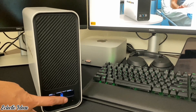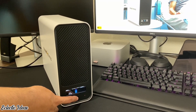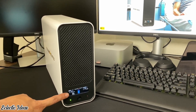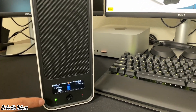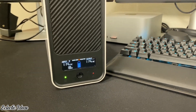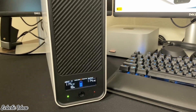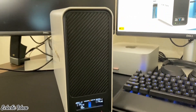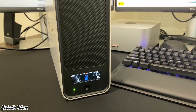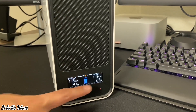We're going to turn off the monitor and the UPS as recommended, then go ahead and plug the monitor in. Let's turn the UPS back on and wait for it to come up — there it is. That readout is from the wall outlet. We powered off the UPS button but didn't unplug it from the wall, so it's still using a directly connected port. Now let's turn on the monitor and see how much wattage it uses — it's using 23 watts of power.